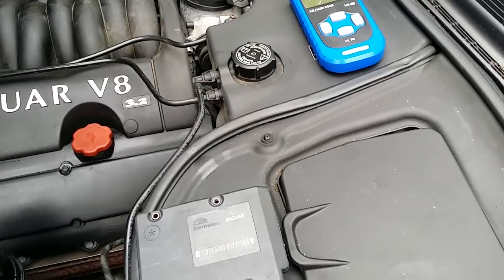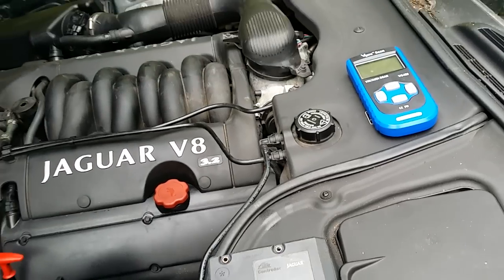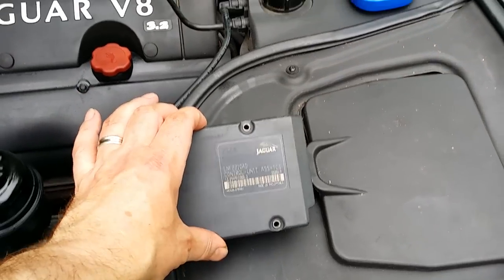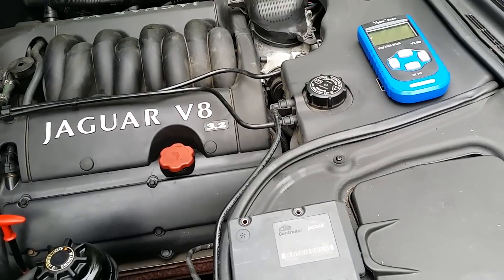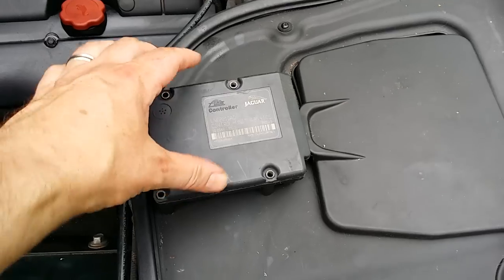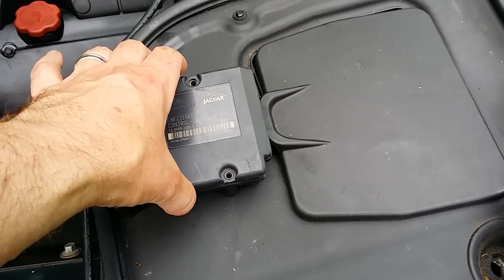Having tried to check the wiring and clean those rear sensors, and even swapping one of those rear sensors, the fault didn't go away. What happened was I was just getting on the dashboard the 'ABS track not available' fault, which suggested that this thing here wasn't returning any codes at all. So I was pretty convinced that this thing was dead, not working. They do go faulty, as I've explained in my other video on how to fix this.